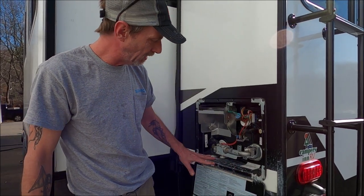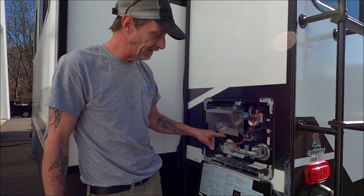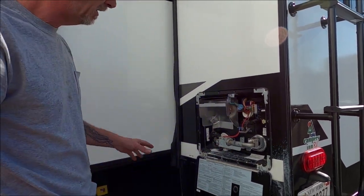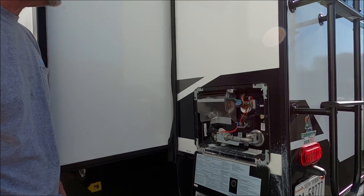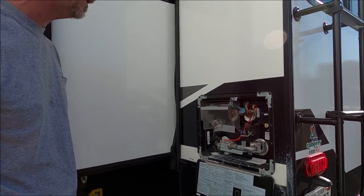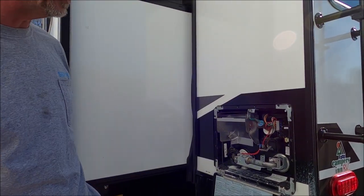The hardness in the water — your tank is treated, that's why you don't have an anode. Being treated, this stuff stays in the water and flows out; it won't eat up your tank, which is really good, and you don't need to replace the anode all the time. Once you get that plug out you're gonna have water flowing, and then you just let it drain.